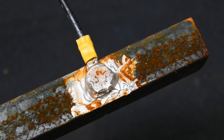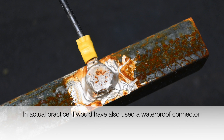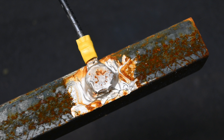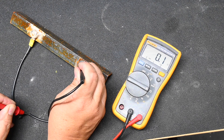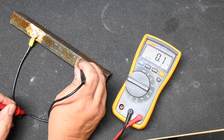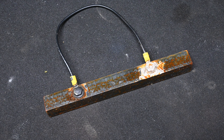I then set the metal bar under a dripping source of water for a week. You can see that with the silver epoxy, I probably should have used a little more quantity, because where it was thin, it rusted through — but there are still plenty of areas where it is thick and there is no rust. On the liquid wire side, it really doesn't look too good. However, when we used a multimeter to check the ohm readings, they both looked good, and when compared to the initial readings, they were virtually unchanged.